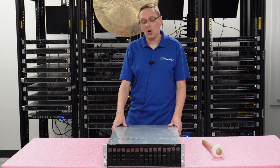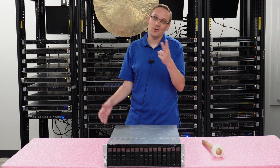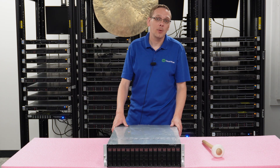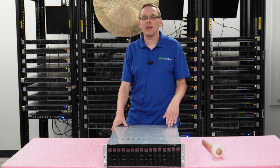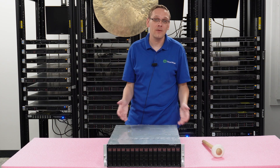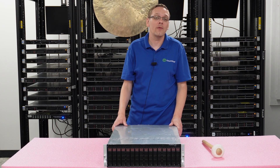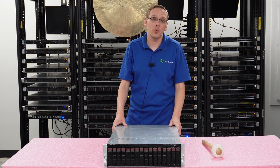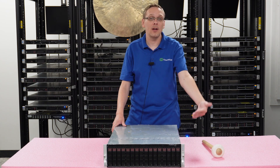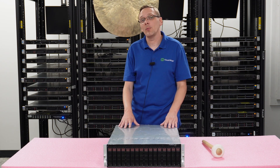There are 16 hot-swap drives visible in the front across eight nodes in the back — that's two drive slots per node, which are two U.2 slots. You can technically put in SATA or SAS drives, but you need a Broadcom chip for that; with Intel, you can only use NVMe. These bays are specifically designed for NVMe, so that's what I recommend. Make sure your 3.5-inch tray is set up for a 2.5-inch drive, since NVMe drives are 2.5 inch. There's also one M.2 slot per node, great for a boot drive.